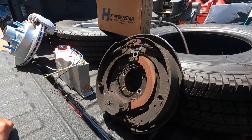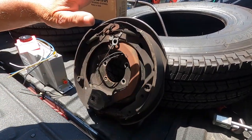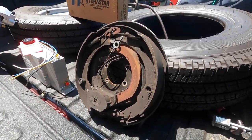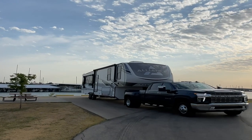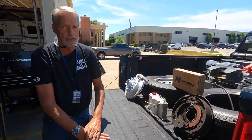Let's talk a little bit about electric brakes — the drum brakes. These have been in existence since almost the beginning of time. Electric brakes work on the principle of a magnet that's energized. When it's energized it rubs against the face of the hub, and that's what pushes your brake pads out. This technology was great when trailers were lighter, but today our trailers are heavier than ever. When you go through a puddle of water — those of you my age will remember cars before disc brakes, where you had to grab the steering wheel with both hands and push down just to get it stopped. The electric brakes are no different than that.